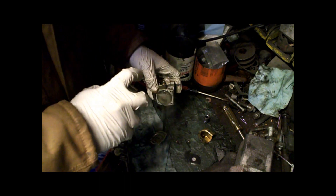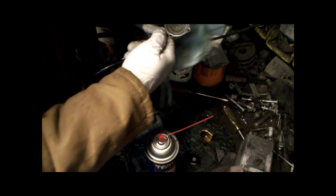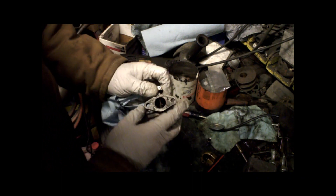We're good. Spray it all down. It's just a little air passage — you don't need to clean that. Get a clean towel. Set that aside, get my carburetor — all nice and clean. I spray, make sure it's all clean through the inside. Let's get my new diaphragm and gasket — I'll show you what I mean.